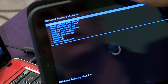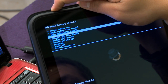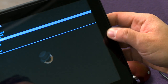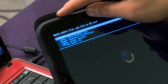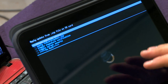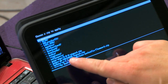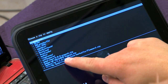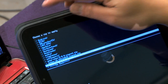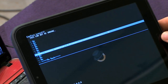It should be familiar if you've played with ClockworkMod from our other hacking episodes. From there, go to Install Zip from SD Card. Your volume keys are up and down, and your bottom key is Enter — just like we did with the Nook Color. Choose Zip from SD Card. We're going to start with the Market Fix, because it seems appropriate to fix the problem before installing other things.